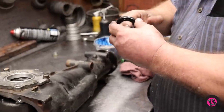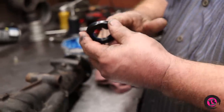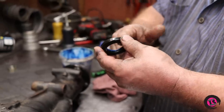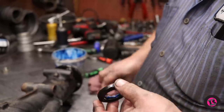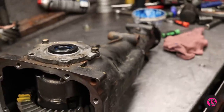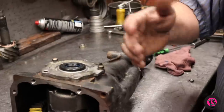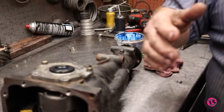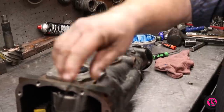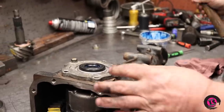Always put a little bit of grease in the seal for pre-lube. We won't need to seal those end caps with RTV because there's an o-ring in there — but when I took them apart they were kind of loose. So we're going to take those back off and put new o-rings on. We can still put the seals in now, and we'll get the new o-rings from the Subaru dealer later.